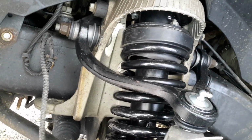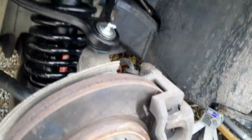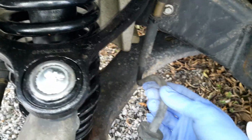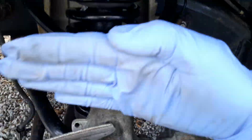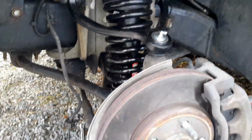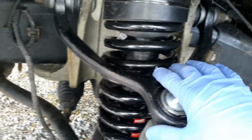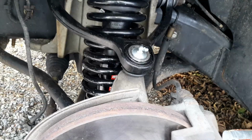And that's about it. Then the knuckle swings forward. The only thing you need to be mindful of, I would say, is this brake hose. You don't want too much pressure on that, pulling on it. So you could turn the wheel this way, so this isn't pulling as far. But other than that, that's it. So this sits up out of the way. The knuckle comes forward.